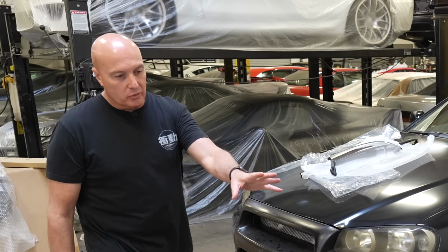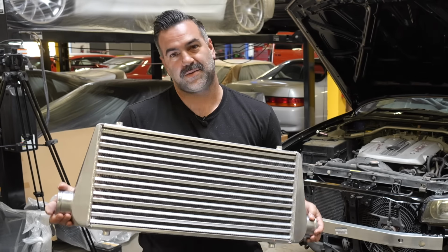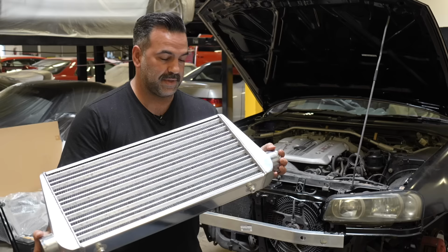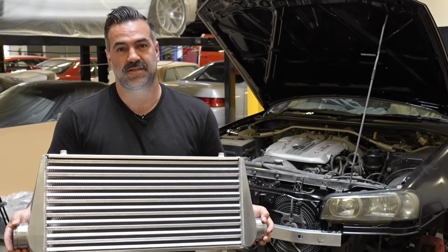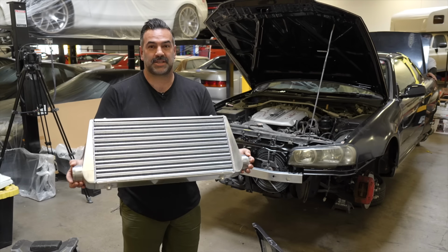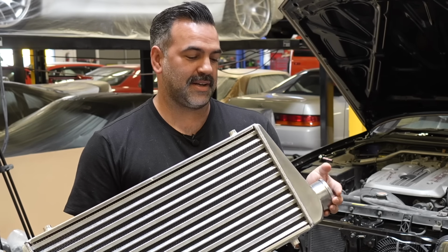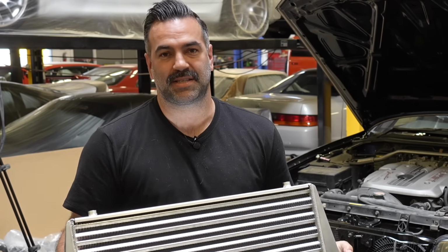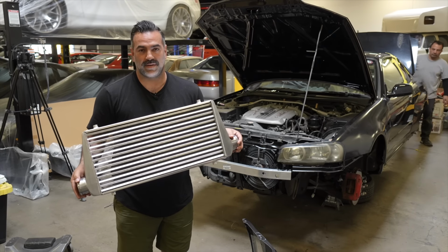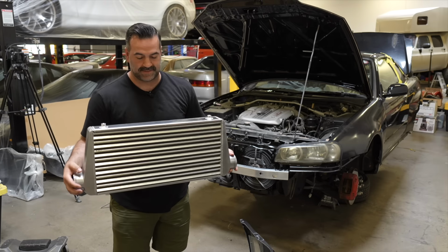We've got the intercooler here. It is rated for 500 to 600 horsepower. We are going to be somewhere within that realm, around 500 wheel horsepower, so crank horsepower is quite a bit more. It's supposed to be made to look like an ARC intercooler. This is not a real ARC intercooler. Those are extremely expensive, and this isn't a real GTR, so this does the job. We are going to have to custom fabricate some brackets to get it to sit where we want it, possibly chop some of the C-West front bumper off. And then we'll add the nitrous cooler ring and the solenoid after.